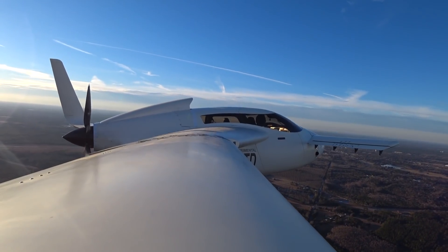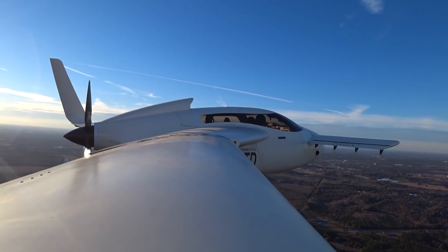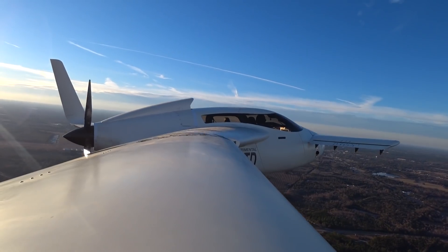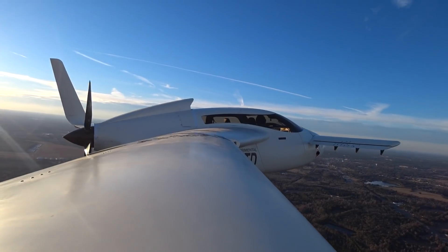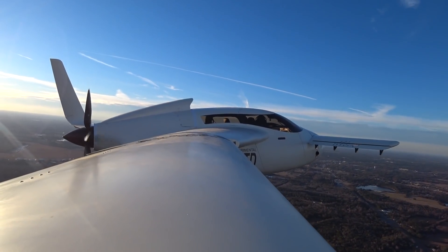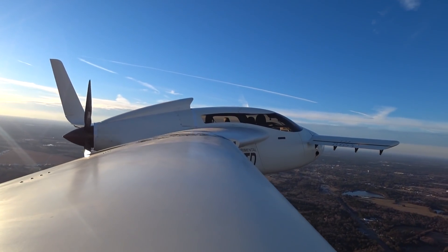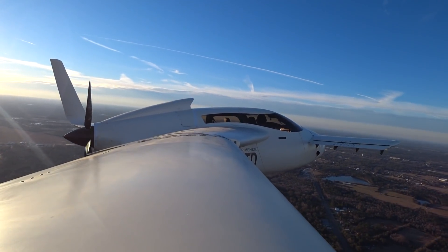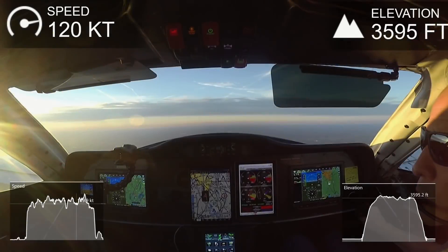The problem is I can climb but not at full power — eventually things just get too warm. Most of these flights have been climbing at about 60% throttle, which is only about 50% power when you've got the prop dialed back. It climbs okay, but it's not ideal. I certainly can't get up to high altitudes when I'm having to climb at such a low power setting.